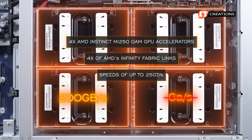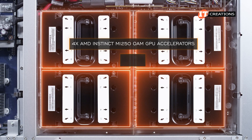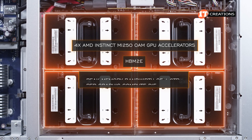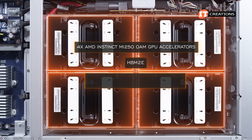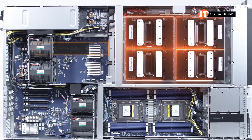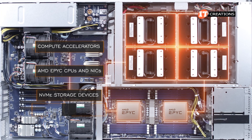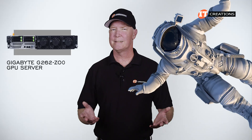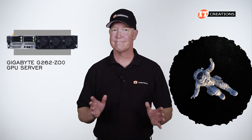Not to be confused with gigabits per second, like on that QSFP56 NIC. The MI250 also uses HBM2E, which is AMD's high-bandwidth memory module, offering a peak memory bandwidth of 1.6 terabytes per Graphic Compute Die, or GCD. HBM2E is twice as fast as HBM2, with double the capacity. All of these compute accelerators connect to the AMD EPYC CPUs and NICs, and presumably NVMe storage devices, through PCI switches. Those PCI switches help moderate data flow.